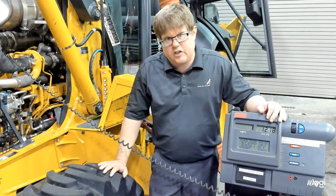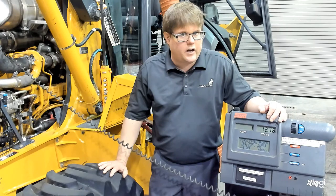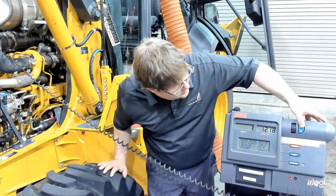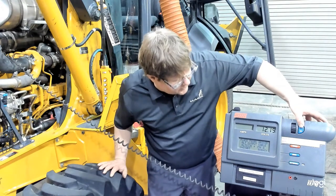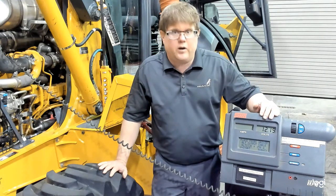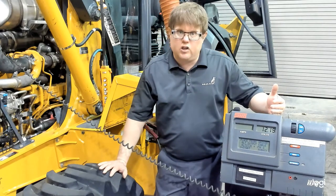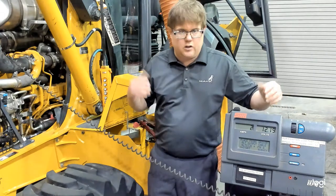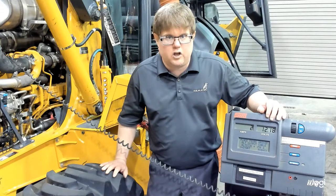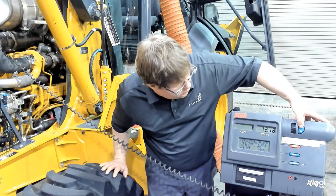It's designed with gas engines in mind. You want to be at least half to three quarter throttle on a diesel engine. We don't always have a tachometer to have an exact indication of RPM. So we're going to press yes that we're ready, and it will now move us on to the next step. You will notice that while we're doing the test, it'll have us run it, and then it will at some point tell us to return to idle so it can test the diodes in the alternator. It's a good idea to do this with the machine facing you in the cab. That's a great way to set it up. We're not doing that for this purpose so that the video will clearly show what the machine reads. But I have someone to communicate to me when to idle the machine down. So let's move on.